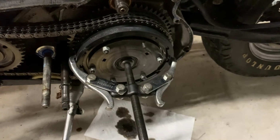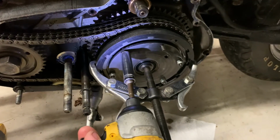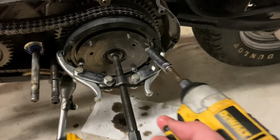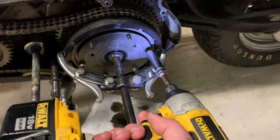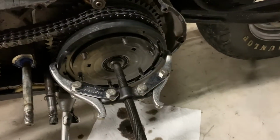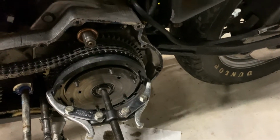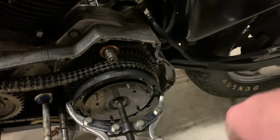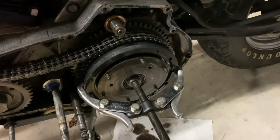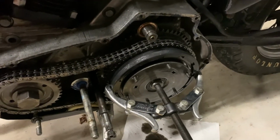All right, push that in pretty far. It didn't have very much tension on it the whole time at all. I'm pulling these off pretty quickly here, if I can get in there. All right, all those are broke loose. I'm gonna start loosening this back up and bringing the tension off of here. You see it slowly kind of working its way out. This outer plate should come off of those studs from the inner part of the basket in there.